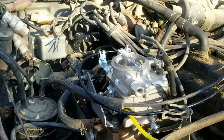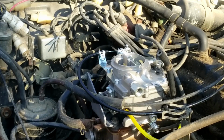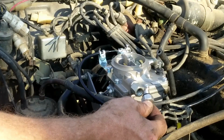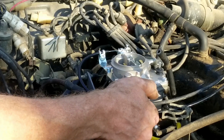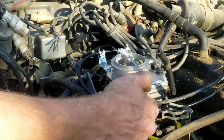All right, this is the last couple of steps, so congratulations if you made it this far. The vacuum advance may now be connected. The fuel line may be connected too. Use clamps on the fuel lines. It is not necessary to use clamps on vacuum lines. We recommend you use new vacuum and fuel lines if the stock rubber lines have become hard and non-pliable.